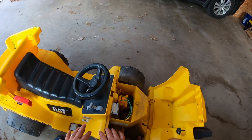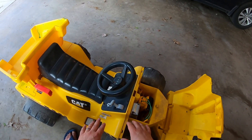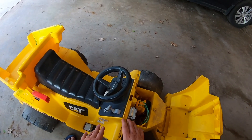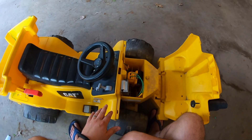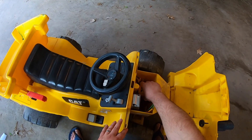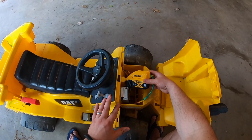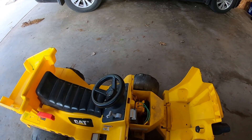One thing I did read when getting ready to do this: make sure your power wheel doesn't have a circuit board in it before you do this modification, as it could fry the circuit board. I looked and mine does not have one, and most power wheel brands apparently don't. If you have an off-brand model, check to make sure, and if there is a circuit board, you may not want to do this modification. Also, look at the amp-hour rating on your batteries — if you have less than a 3 amp-hour battery, you probably don't want to use it, as it'll drain too quickly and will probably eventually ruin it. That's all there is to it — if you found this video helpful, please give me a like and subscribe. Thanks!